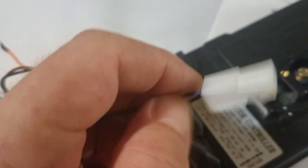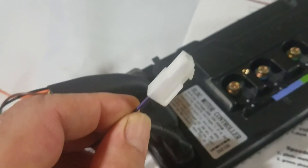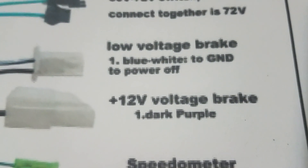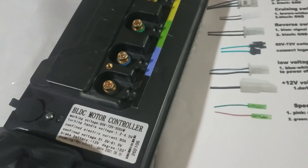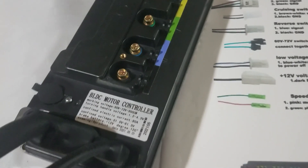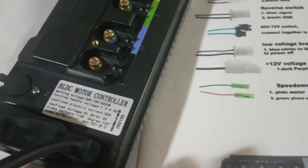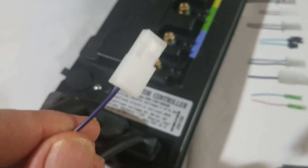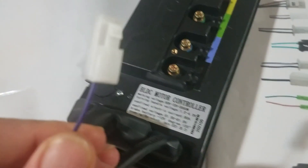This dark purple — a lot of people confuse it with other wires. This one is your high brake. By my understanding, it says 12 volts right there. Normally you'd put full battery power or 5 volts, but this one specifically says 12 volts. So if you have a 12-volt system — it reduces down to 12 volts to run your lights — just hook this up to your brake light so when your brake light comes on it does dynamic braking through the motor. That's your choice, it's not necessary.